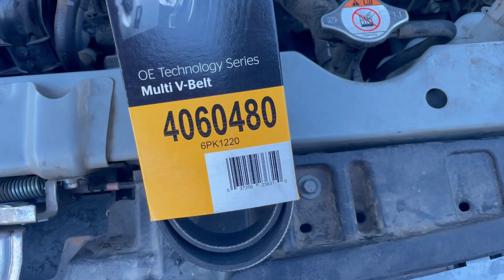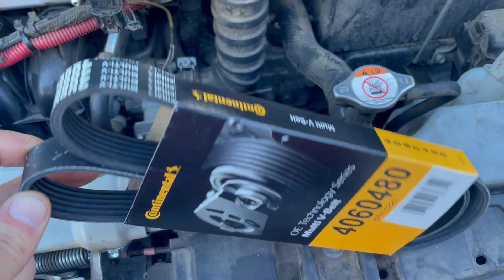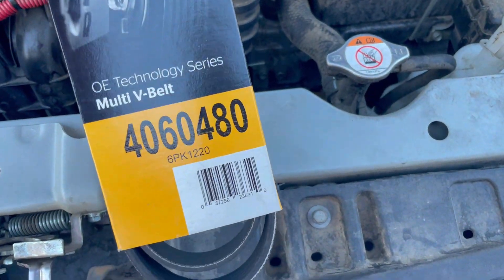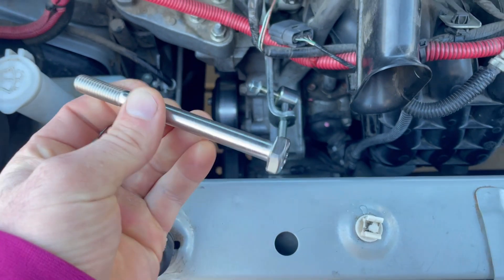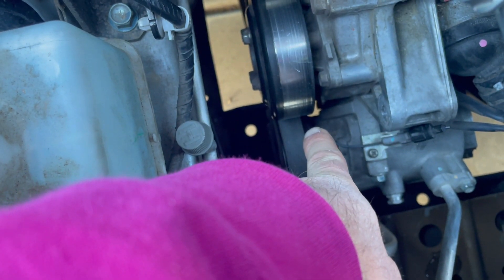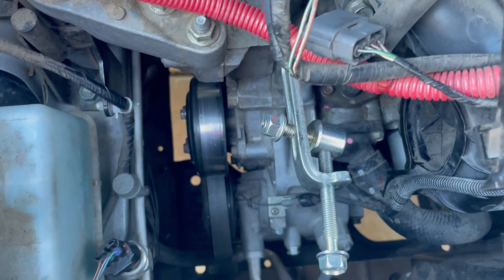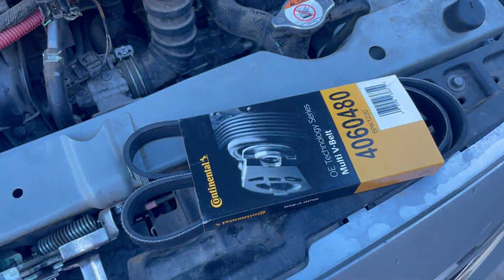Made a little hardware store and AutoZone trip. I got a shorter belt because aftermarket alternators have smaller pulleys so you've got to run a shorter belt — it's only about a half inch shorter than factory. I also got a longer bolt to run in here because I want it to come out past the end of the alternator to use as a mounting point for a ground when I do my big three. Those are the parts I bought to get ready for this install.